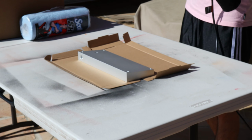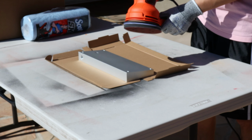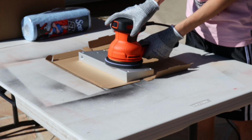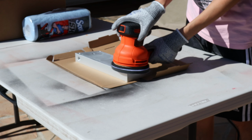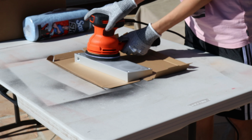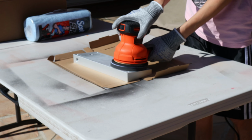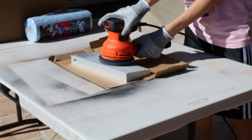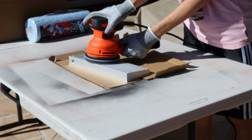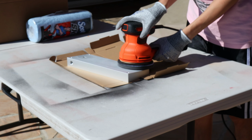To begin the polishing process, we first need to remove the anodization layer and begin to smooth out the surface. In order to do this, I opted to simply sand the case and use progressively finer grits. I'm using a random orbit sander, which should make the process a lot faster with a more consistent finish. I bought an assortment of sandpaper grits, so I just started with the lowest number and kept advancing to higher and higher numbers as I went along.